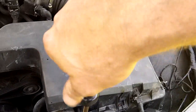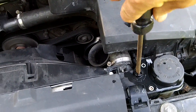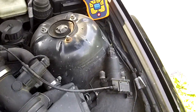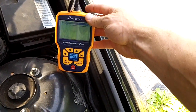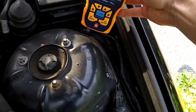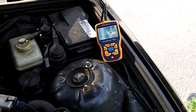That pretty much tells you that the thermostat is either opened or it's pretty close to opening — water's moving around in there. When you tighten these up, you don't have to use a lot of force. Just put your screwdriver in there and snug it down — we don't want to break the head off the thing. Looking back at our gauge, we're at 198°F right now. So the thermostat opens soon, but the fan won't switch on for a while — just a couple more minutes.